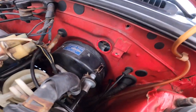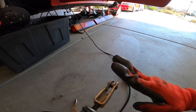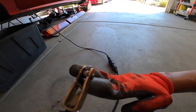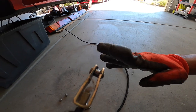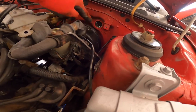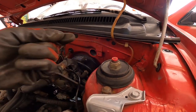As you can see, the little horseshoe is out and we can go ahead and pull out the clutch cable. Imagine the pedal kind of sits this way and there's a little hook — you just push the horseshoe over and hook it onto the pedal, and when you're removing it you slide it back and pull it off. I'm going to go ahead and spray some all-purpose cleaner in here to clean out the area — there are cobwebs and dust — and then slide in our new cable.